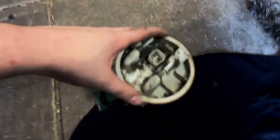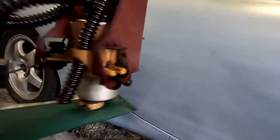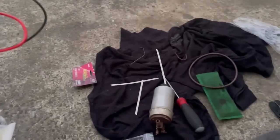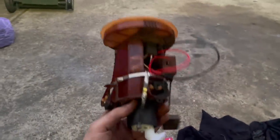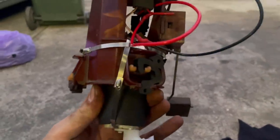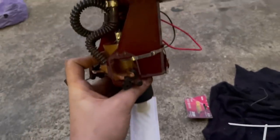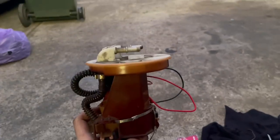Well that took forever. I've never done one of those before — it had those stupid snap lock fuel lines on them. That took ages to get off, and there's a locking ring that goes around it which is a pain. Here's our old assembly and here's our new pump — you can see the way it's mounted. I'm going to try and mount the pump a little bit lower. The lower it is, the easier it'll pick up. With the 255 we've also got more power. So here's my ghetto fuel pump setup on my phone camera — the Walbro 255 in there. It's much smaller inside the cradle than the existing pump but it flows a lot faster. I've rigged it up with some metal zip ties, dropped it as low as I can, wired it into the factory plug, and got the sock on there.